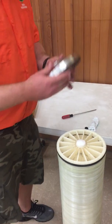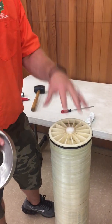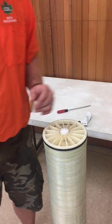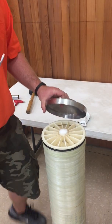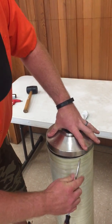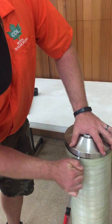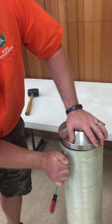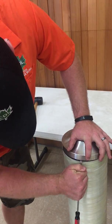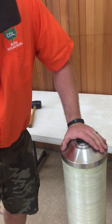Finally, we have our stainless plate cap adapter, which adapts the membrane down to the submersible pump — your recirculation pump in the post. We're going to put that on the membrane by using our flathead screwdriver. You'll start that and then take your screwdriver and work your way around to make sure that none of your U-cup is pinched. It'll set right on.